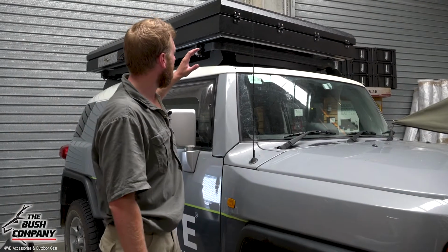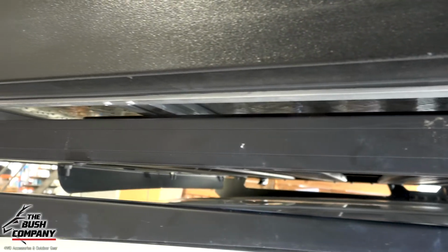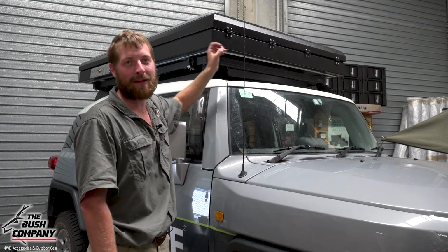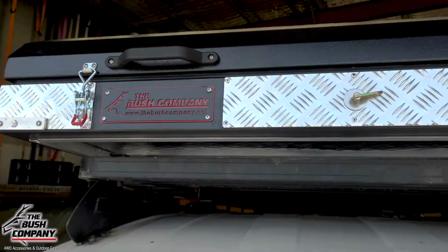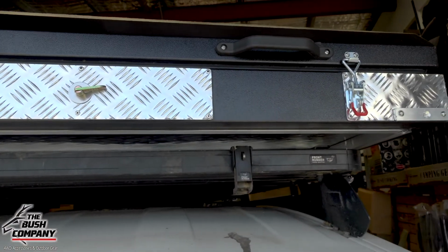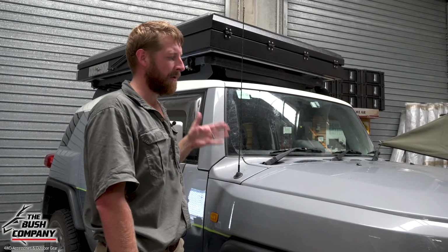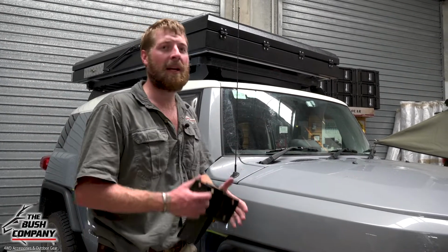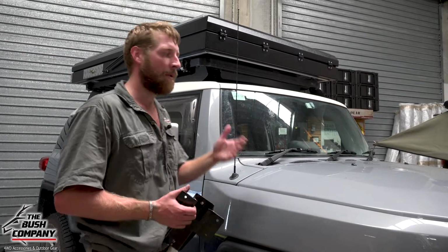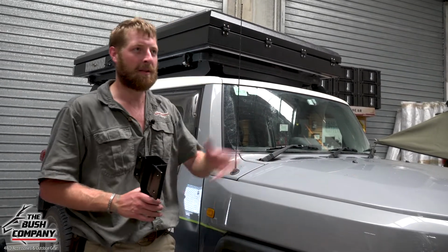Alrighty, so what we've done is we've fitted the rooftop tent onto the front on a roof rack. This was a pretty easy install once we had the Z rails in place, and the Z rails definitely proved to be the best choice in bracketry. I've positioned the tent a bit more forward, and the reasoning is that it's lining up with the rear opening door. So this vehicle is also getting an install of an awning done, and because the door of the FJ Cruisers opens up basically hinged on the passenger side of the vehicle for Australia, better suited for the US markets, I suppose, with your drivers on that side of the vehicle, we had to get in a special awning, or we've looked for an awning that is the opposite to the usual situation on the left opening.